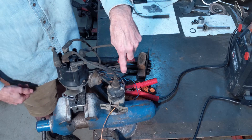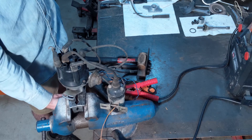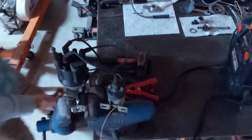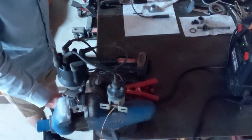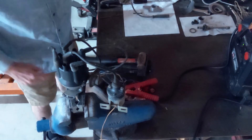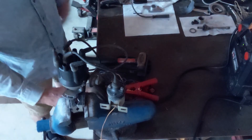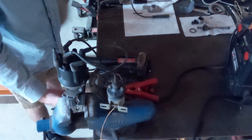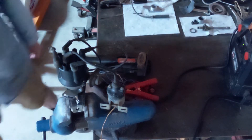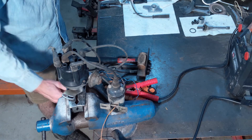And I'll turn the lights off so you can see it better. The coil is old and crap so it's arcing out to a couple of the posts here, so you'll see that as well. Most of the lights are off — all the spark plugs are firing. It kind of doesn't seem to matter which way you turn it. You can see the coil arcing out there a little bit.